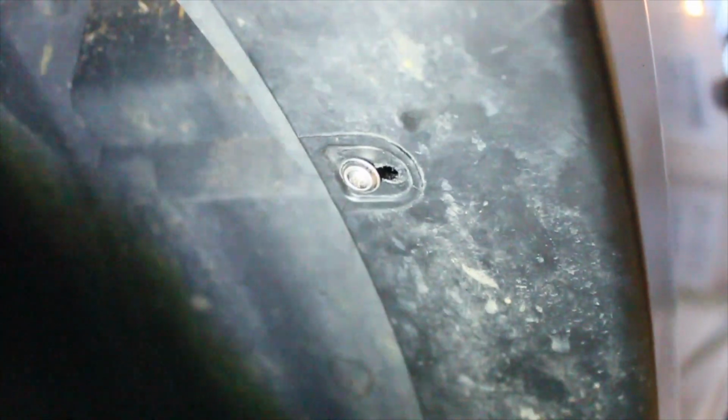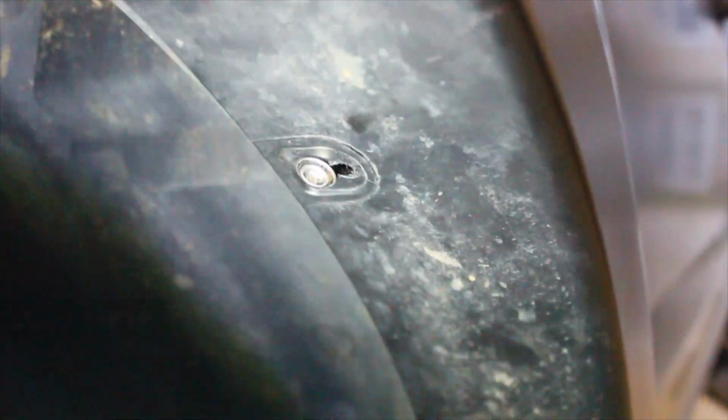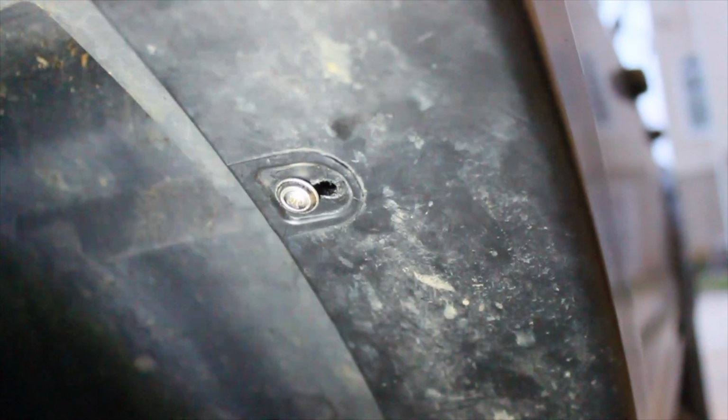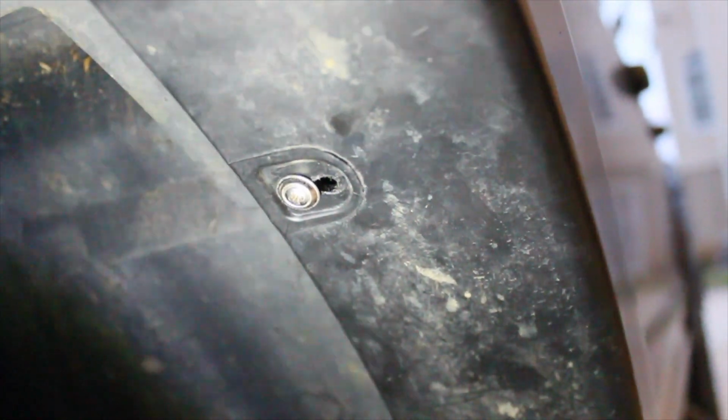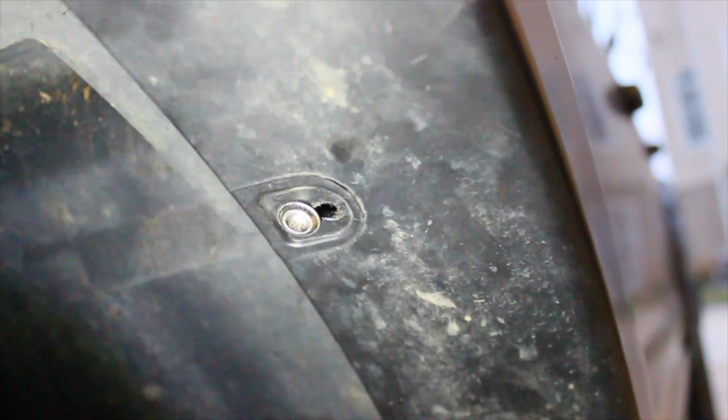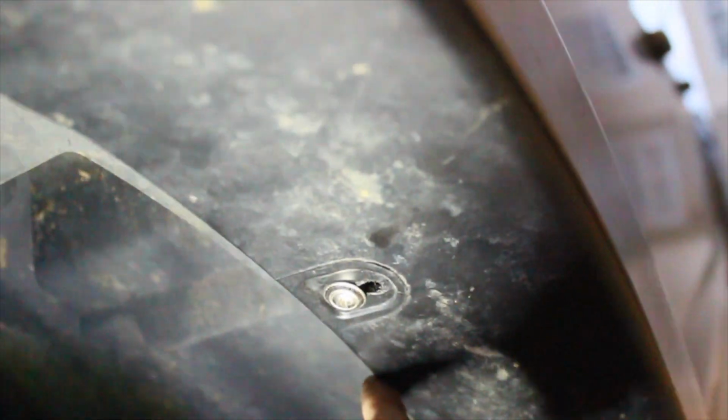So like I said, you have to drill a new hole into the inner bracket. One thing I noticed real quick, you might want to get some higher quality drill bits, because if the U-clip is there, then you're going to be spending quite a bit of time trying to get a hole through that metal clip. What I did was kind of just moved it out of the way, and I attached it to the plastic of the inner bracket. Now that is still on there, guys. The inner bracket, remember, is attached to the fender pretty well, so as long as we're on the bracket, we're good. We are in business, folks.